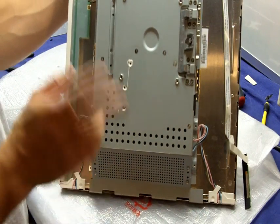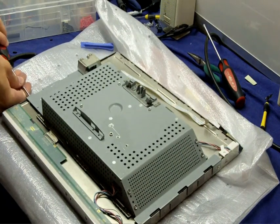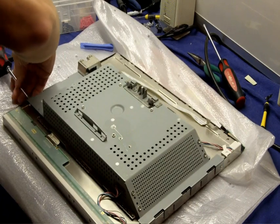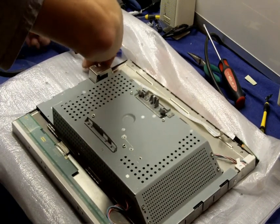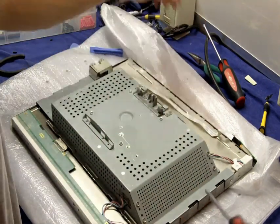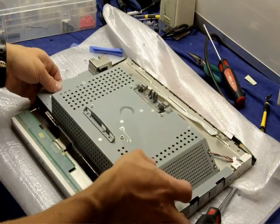There's a white ribbon cable on top that simply pulls out — nothing is holding it in. The ribbon cable on the bottom, you need to be particularly careful. There are four screws on the side of the monitor holding the chassis for the boards and circuitry onto the LCD. Once those are out, there's a very large ribbon cable with no clips — it's simply held in by pressure. It has a little bracket glued onto a metal piece behind it that we'll twist off and break loose.